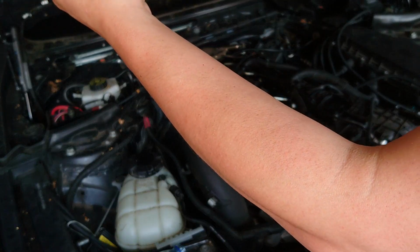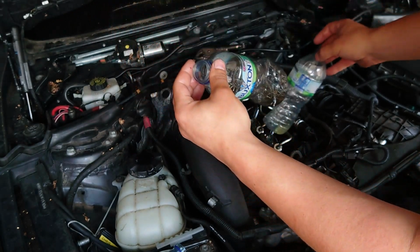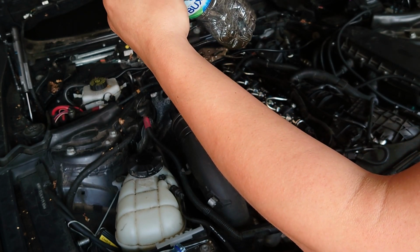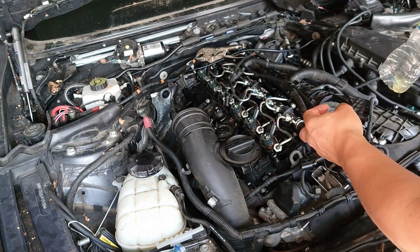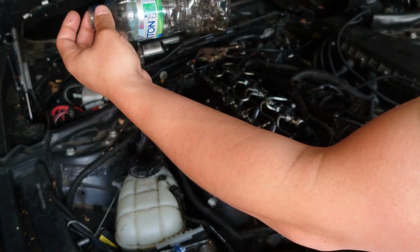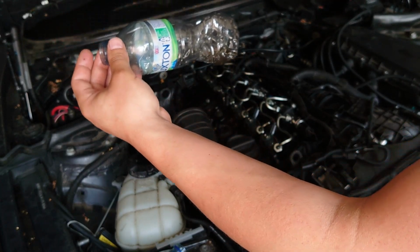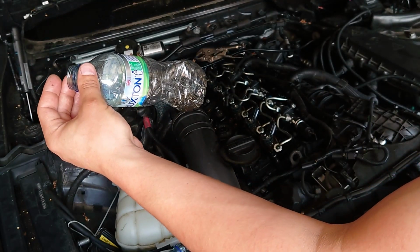So to me, this is clear: the injectors are not working right, and the main bit on the body is gone, it's rusty. Because let's think, this has to create pressure before the injectors fire, yeah? So why does the diesel come out like that? Number 1 is behaving how it should. This is the amount of diesel that has to come out when the car is idle. And for 10 or 15 seconds of cranking, I think this is excessive.